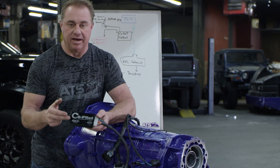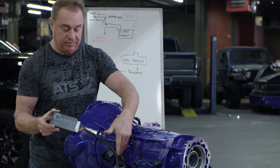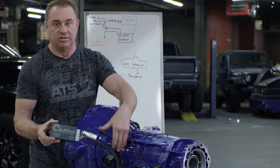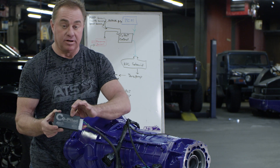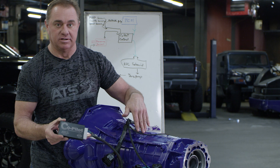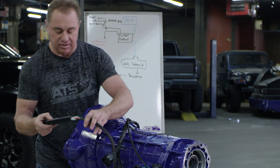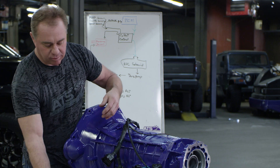You don't have a faulty $70 transducer causing your transmission to fail because the voltage is off — where the ECM might think there's 100 PSI in the transmission when in actuality it's only 40 PSI. We see a lot of 68 RFEs come in here with bad transducers that drove line pressure lower than healthy, causing transmission failure. Because of that, we've put a lot of fail-safes into the co-pilot computer to ensure it never allows the transmission drive to go below a safe standard.